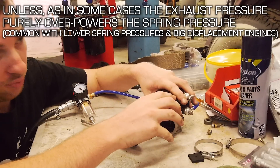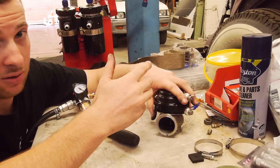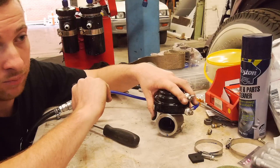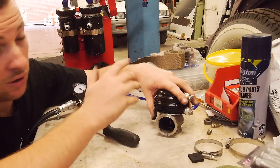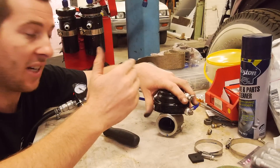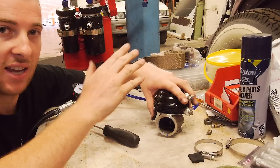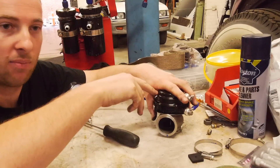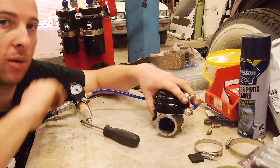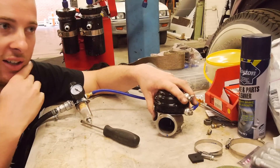You're putting that boost pressure on top of the plunger and holding it shut. So if you're running purely on the wastegate spring it will start to crack like that, which isn't ideal. But when you're running an electronic boost controller it will keep that shut until the very last minute — that's basically what the gain control is on the electronic boost controller. It says how long to hold that boost on the top port until you want to hit full boost, then it lets off and the gate opens. That gives a more hard-hitting kind of feeling, which I do like in my cars if the car is built for it.